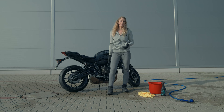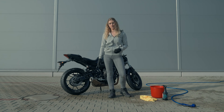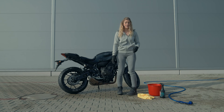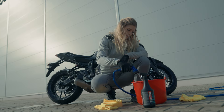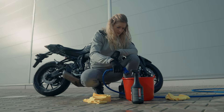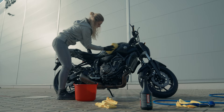At this point, it could be a good opportunity to get yourself a warm bucket of water — partly because it is much nicer on your fingers, but also because the warmth does help break the grease down. The product has been sat on the bike for a couple of minutes now, so it's time to get my sponge out. I'm going to use a little bit of hose pipe water to get my sponge wet, and then it's a case of methodically working your way around the bike to get into all of the different panels and crevices and wipe that dirt away.